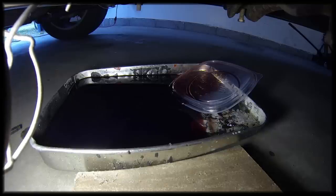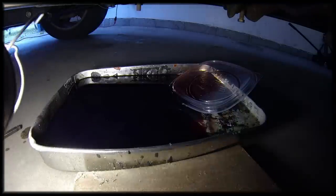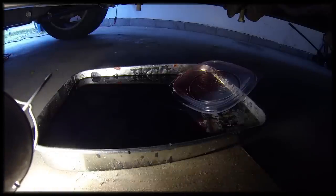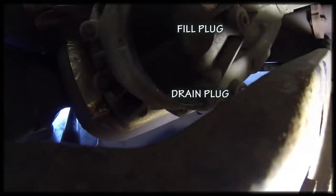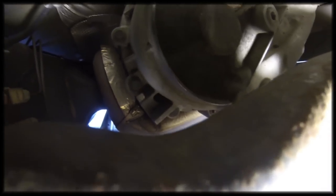I've been letting it drain for probably 10 or 15 minutes. Now I'm going to take the fill plug out — that's the top one — replace the drain plug, and then we'll replace the fluid. Here's a hole in the cross member which you can use to access the drain plug. Here's the back of the transfer case; you should be able to see the fill plug and maybe the drain plug down there at the bottom. Both of them are 10 millimeter Allen heads.